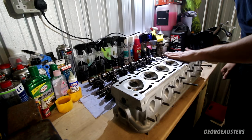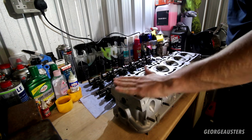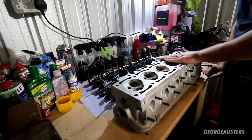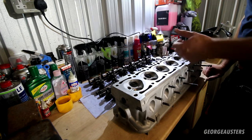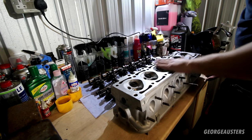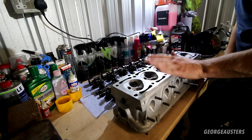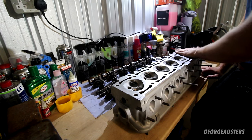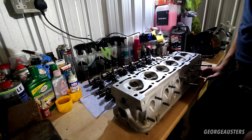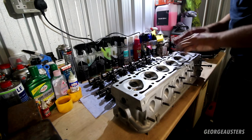As you can see, the face is so, so good. I have checked it with a straight edge - no discrepancies there. I don't think the head has been warped or anything like that, and the head gasket was near-on perfect, so I'm happy to proceed. I'm not going to skim this head. There are a lot of people that when rebuilding an engine just skim the head and face the block for no apparent reason - if you do that you're going to need a thicker head gasket and all the rest of it, so if it doesn't need doing, don't do it.